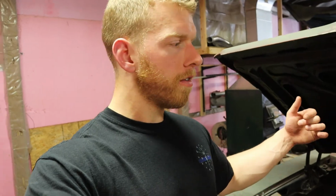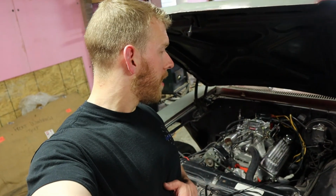So yeah, I can't tell you exactly what it was that fixed it. I honestly think it was just a mix of a lot of things, because regardless of what I was doing, it never was really happy. The advancement of the timing obviously is what got it to start this time. But the weird thing is that I advanced the timing before I put all this other work into it and it wouldn't start. So obviously plugs needed to happen anyways. But I think she's much happier now. So she is dialed in to a T. I'll show you. You just turn the key and she fires right up.